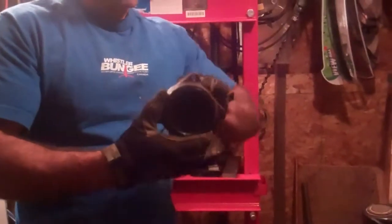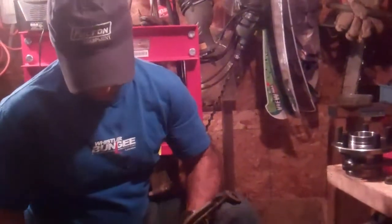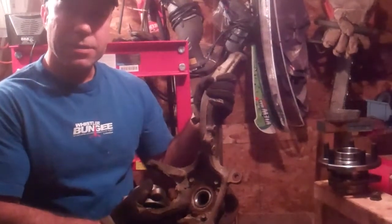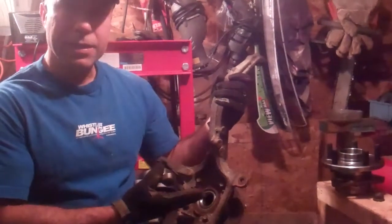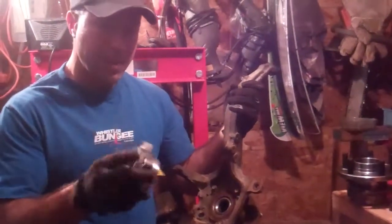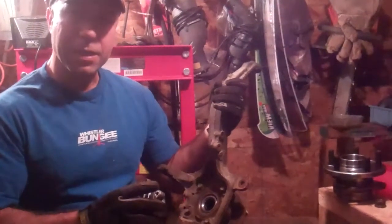What happens is when this bearing eventually wears out, your driveshaft is going to kind of move within it. To go back to our scenario: here's our steering knuckle. The bearing wears out, so what your mechanic is going to do is get that bearing out of the hub assembly — this is what we're talking about with the bearing. And here's the part where you might be willing to spend a little extra cash.